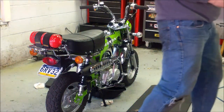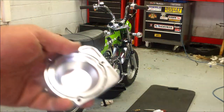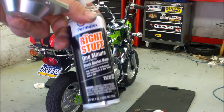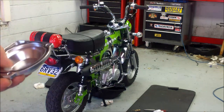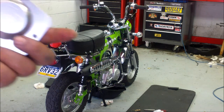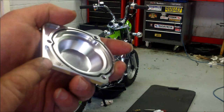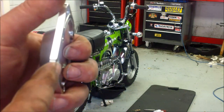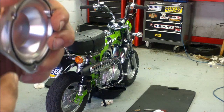Here's a little update - when I was breaking it in, it was leaking around the cam cover. Turns out the o-ring they put in is recessed down too low so it's not touching and it's leaking. I'm going to use 'The Right Stuff' - if you ever use this stuff it's the best for sealing oil. However it bonds so tight it makes it hard to remove. So on the back side of the cam cover I filed a chamfer so that if I ever need to get it off again I can get a screwdriver behind there and pop it off. It's not where it seals so it won't leak.